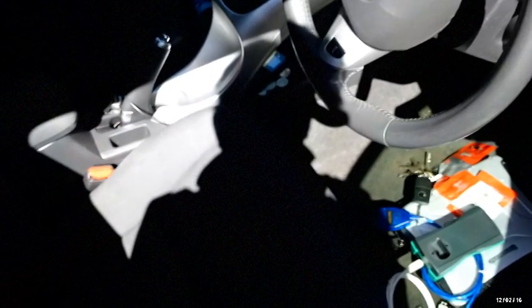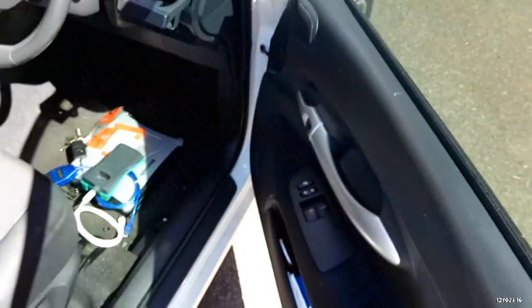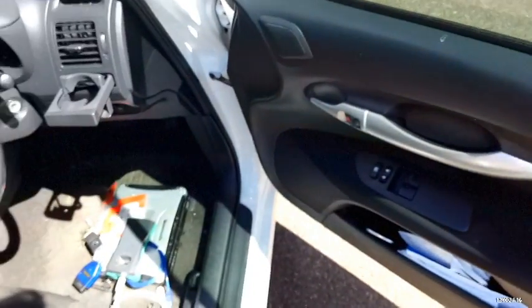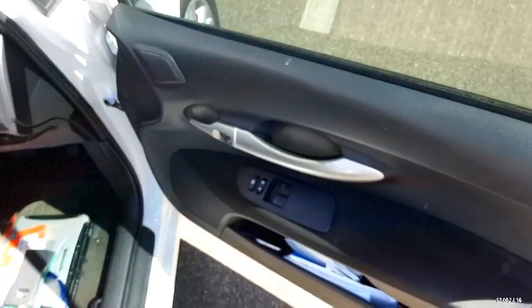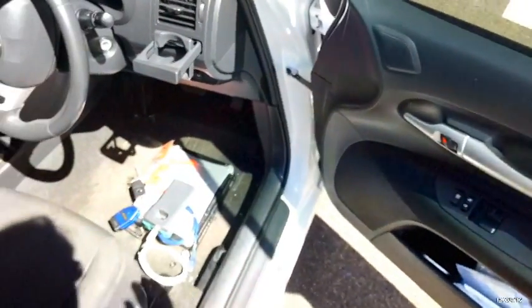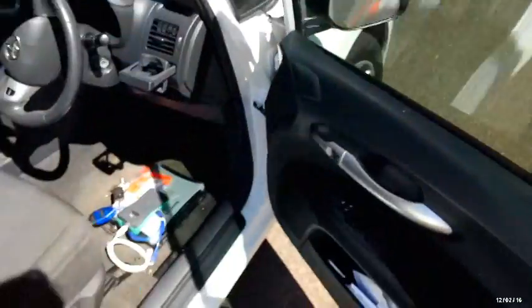which is the Lishi 2-in-1 tool to allow you to pick the door, decode it. There's also another way of making a key for the door. So you could use this tool right here, open the car, decode it, or you could remove the side trim here, remove all of this, remove your lock, and do it that way. We've gone for the third option, which is easier, and that's by getting a code from the dealer, saving the customer time and money. And then we've cut the key.